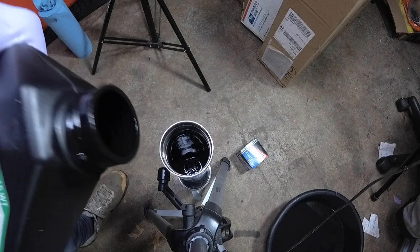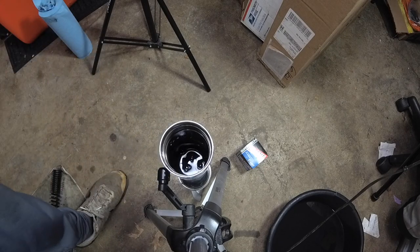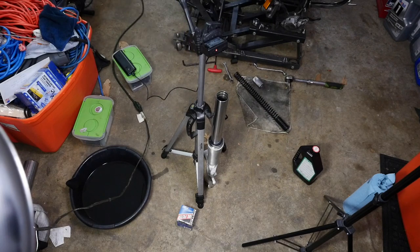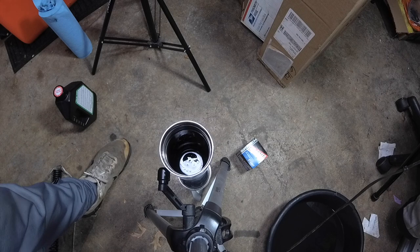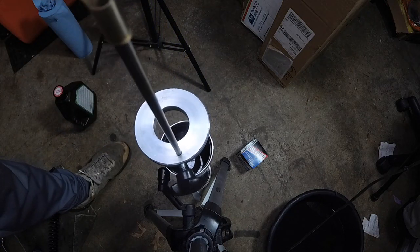Now also, this won't be the end of it. They say to pump it at least 10 times. Oh, that's definitely going to suction up some. Let me just check something. Okay. Yeah, so in the manual, the page is 4-57, that's what gives you the information for emptying and filling the forks.